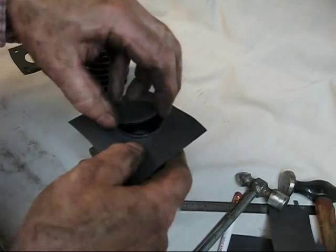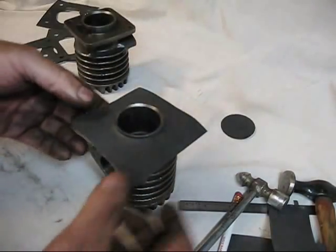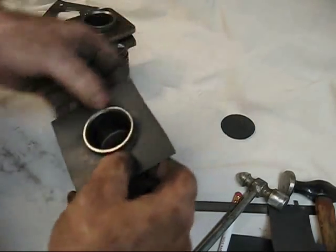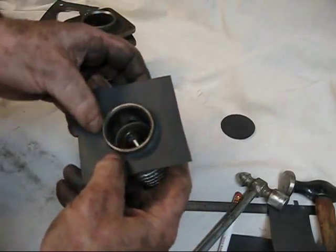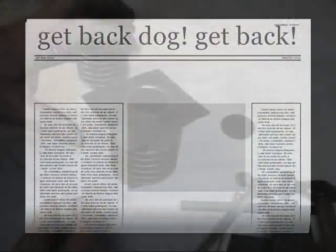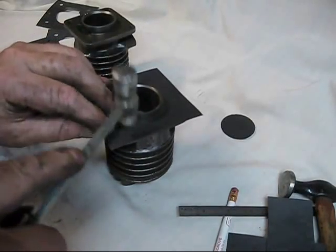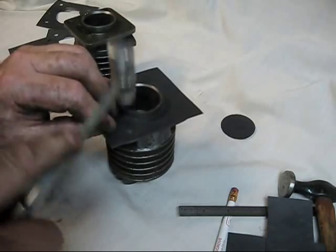With intent. You need to know where all of your hammer blows are going to end up, and you only want to go around the amount that it takes to cut the gasket free. When you did that, you got this little circle right here that you cut away. Now you have a perfect — remember that word, write that down — a perfect fitting gasket up to this point. The next thing you want to do is the bolt holes; they need to be equally as precision.